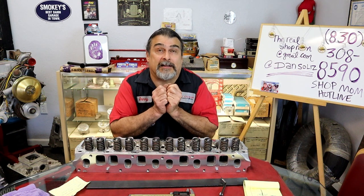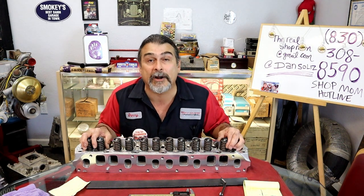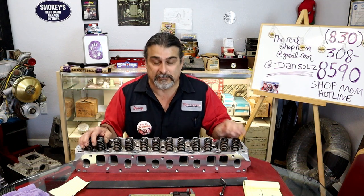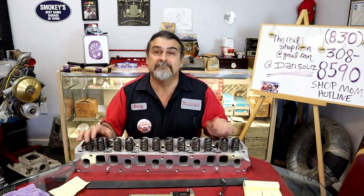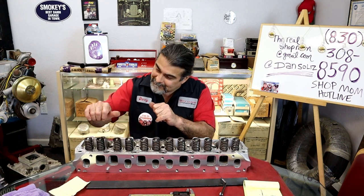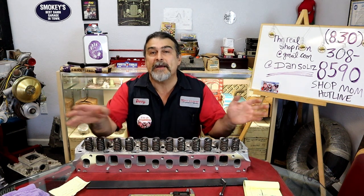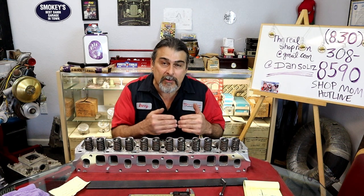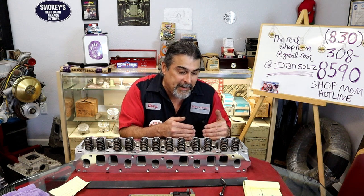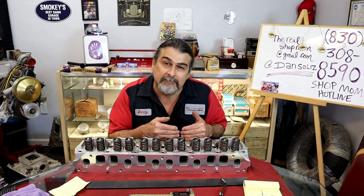That's the first thing. If you were like a kid, what do I do? Take you a toolbox, go to a scrapyard and start breaking bolts. Start on the oil pan bolts. Start turning them till they break. Do a couple. Before long you go, oh, I know how much is tightening and how much is breaking, right? Go break bolts. That is really the best way to know how it feels in your hand when a bolt's about to go. That makes sense?